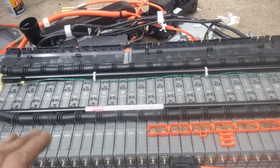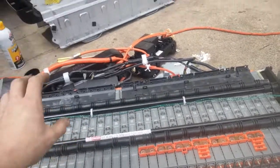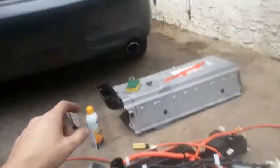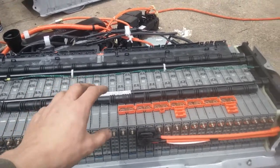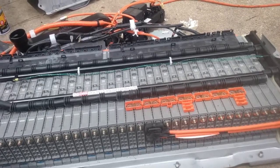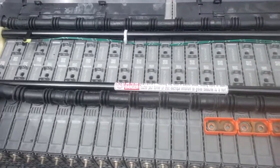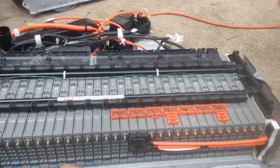Some of these batteries actually had an issue with the original design — it was a row of tubes that almost looked like a Gatling gun if you looked straight at it, and they didn't have a fan on it. This one actually has a fan that blows across the batteries. What would happen with the old design is when those batteries charged and heated up, the ones in the middle would overheat and fail the soonest. They revised that design and added a fan, so now these things last a little bit longer.